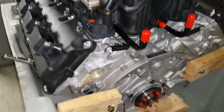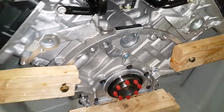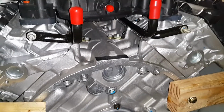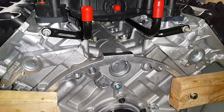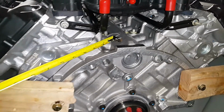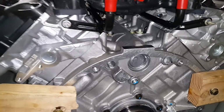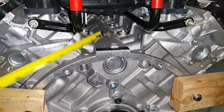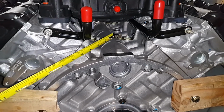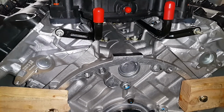If I pan down around to the rear, you can see the block a little better. It's the older 6.1 aluminum block design from Aero Racing. They cast these blocks a couple of years ago. You can see it does not have the ribbing that's available in the 7.0 and 6.4 Drag Pak blocks that are available from Mopar.